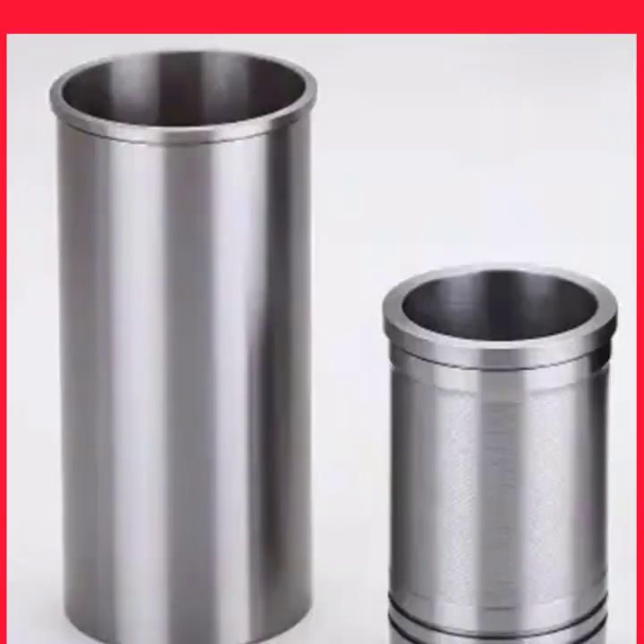And when you remove a dry sleeve, you will not see coolant on it. But when you remove a wet sleeve, you will definitely see coolant on it because there is direct contact with coolant. In terms of dry sleeve, you will not see direct contact. And one of the characteristics of dry sleeve is that it is always lighter than a wet sleeve — always lighter.